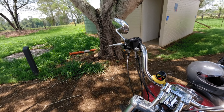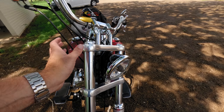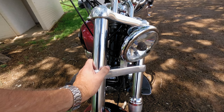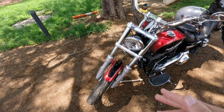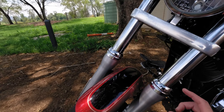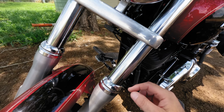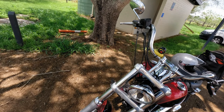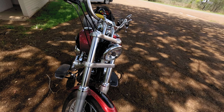While I'm at the front, I'll talk about the front suspension. What I've done is put progressive heavy duty shocks from the company Progressive, and also changed the weight of the fork oil. What that seems to have done is made it a much harsher ride. On the way in here we had a very bumpy bridge, and these forks are barely moving up and down - I've yet to see them go much higher than that. That has a positive benefit if you're a hard rider - you're not diving under brakes - however on cruises you are feeling every single bump.